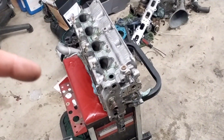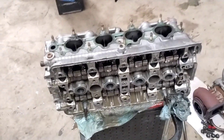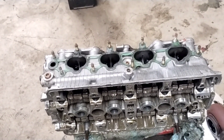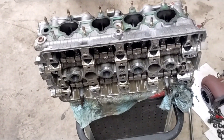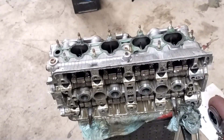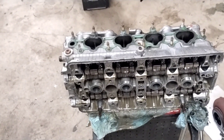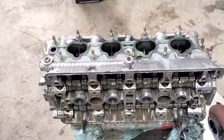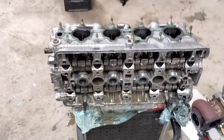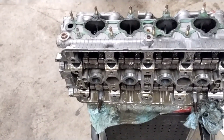The oil is not good, so if I ever plan on reusing this bottom end I'll clean up the pistons and check the bearing clearances, because it did run great and the oil pump still had great pressure. The cylinder head is an easy fix — get it flattened and reuse it. I was always under the assumption that I had the built head on this, but this is actually a stock H22 head with no upgraded springs or retainers.